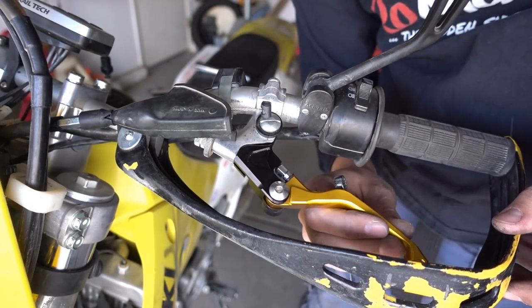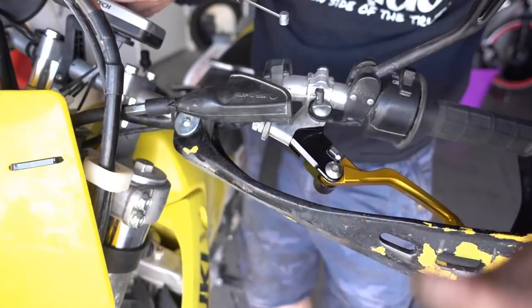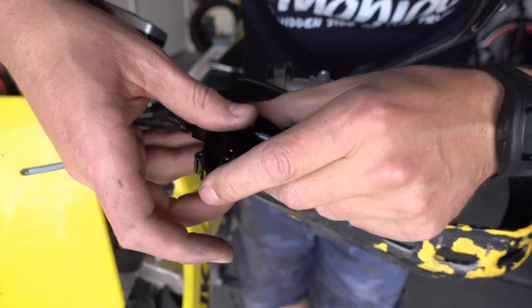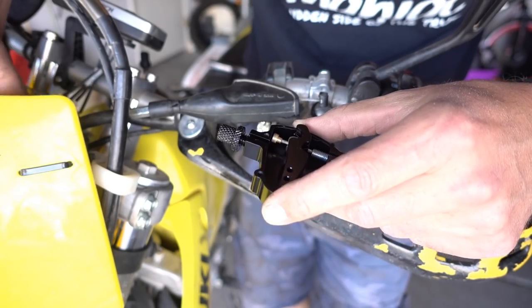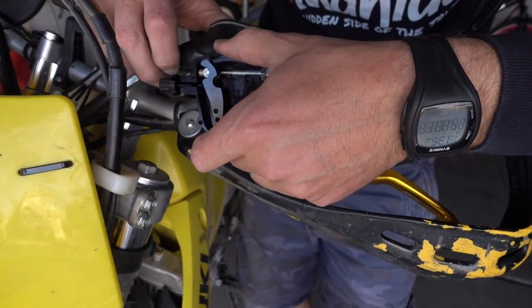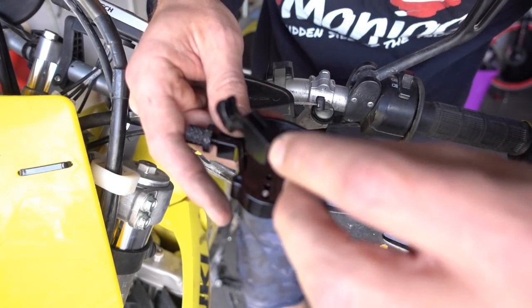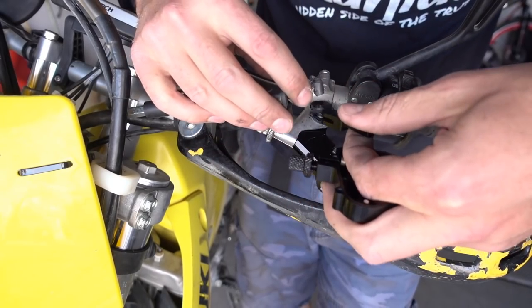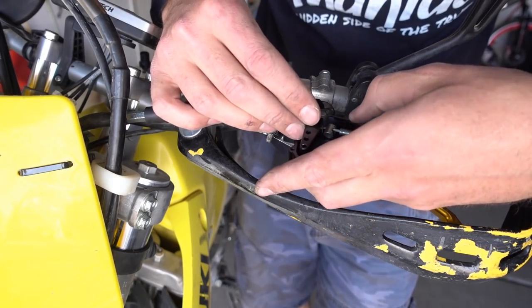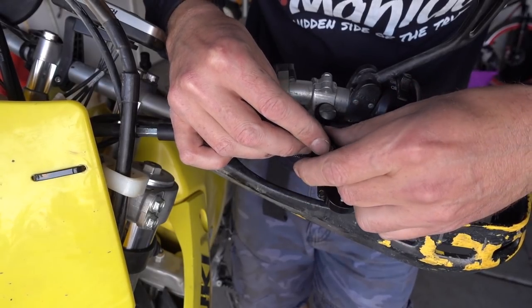This lever is not only flexible forwards, but also has an adjuster so you can make it longer or shorter depending on where your fingers are. At this point, you are ready to install the reducer. You'll have to find some extra space for the cable inside the handlebars because you're going to extend the cable by about six inches — that's something to keep under consideration. You remove the inside part, and this will just slide through while the inside part stays with the cable.